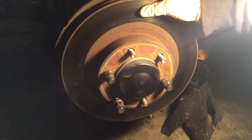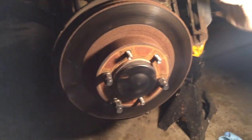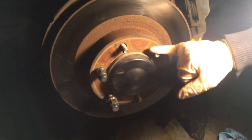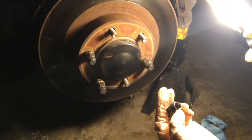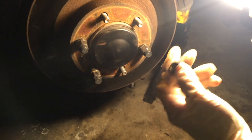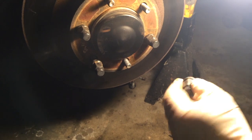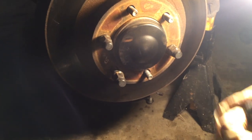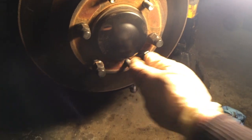One tip: I put some lugs back on just to hold the rotor in place while I put the caliper back on. This is also a good time to use some anti-seize on the threads. I believe one of my old lugs got a bit corroded inside — I certainly didn't over-torque them — and it fused on, and when I was rotating tires a week ago it snapped off that bolt. I've never used anti-seize on these before, but I have new lugs with new threads and I'm going to go ahead and put anti-seize on as well.